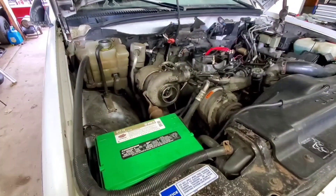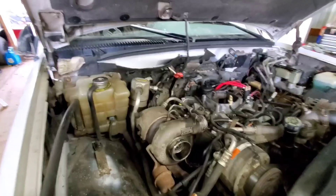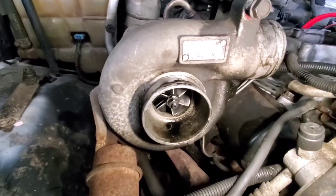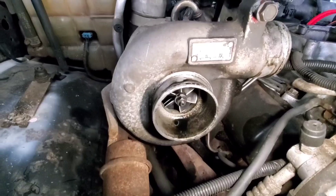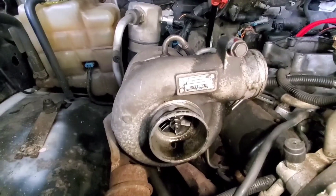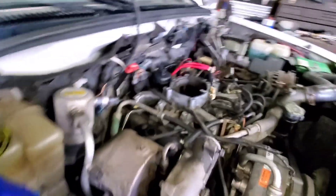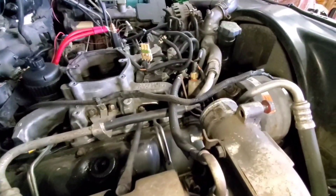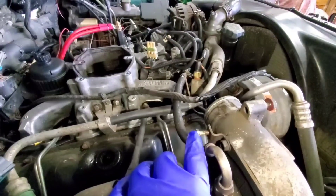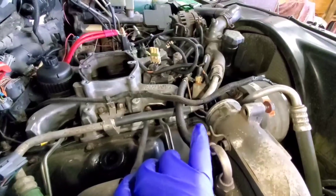Now that we got the plenums off - there's no right or wrong order to do this, this is just the order that I do it in and it makes the most sense. You can see how juicy the inside of that intake is, inside of that turbo. This truck is going to need a CDR valve, or probably even a catch can. Next on the docket is pulling the turbo off. Quick side note - there's a little 11-millimeter that holds the CDR in place to the back of the turbo, so don't forget to do that. If you have an aftermarket turbo you won't have to worry about that.